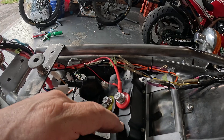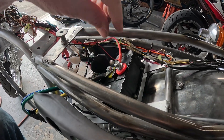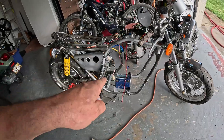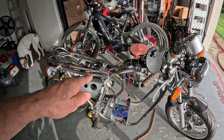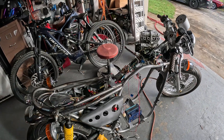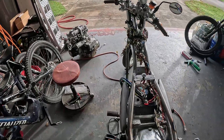The battery is always on — power is always going to the positive and negative posts — but the controller is not on until we tell it to. The controller is essentially off until the orange wire receives your battery voltage from the key. When that orange wire turns the controller on, it allows the electricity to flow. So long as your key is off or the orange wire is disconnected, the controller won't turn on — it doesn't get much simpler than that. When I get the battery I'll do a video on setting up the Far Driver with no display, just a boost switch and throttle, and I'll explain the settings I use to keep it safe for the user.